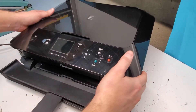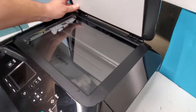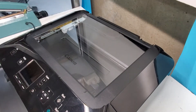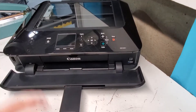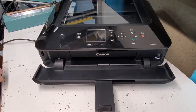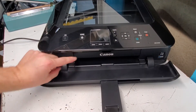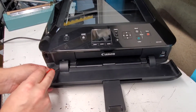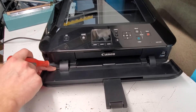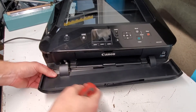This top cover just opens up like that — I'm going to pull it up and pull it out like this by pushing those tabs back. The front tray, the paper output tray or stacker tray, has tabs on this side and this side. On the left side of each hinge there's a tab — I'm going to put a screwdriver in here and push it like that, and it slides out.